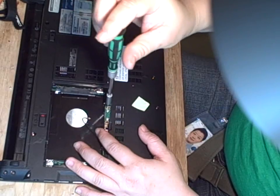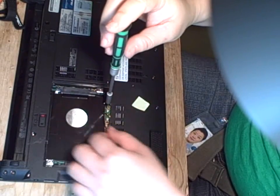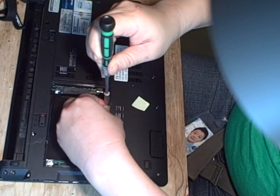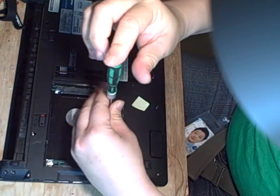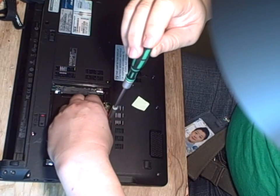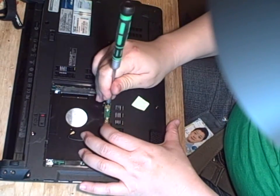One of the quickest hacks is to put in another antenna on the stock card and resolve the problem with wireless connectivity. I just pulled the antenna, and the wireless card is also held together by two screws, so I'm going to remove the two screws. It should slide out once you've done that.